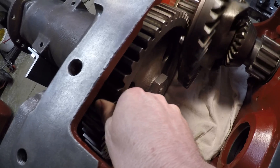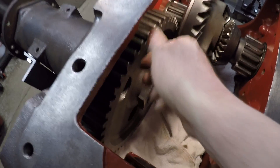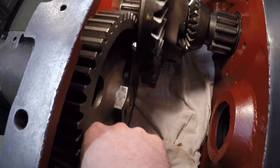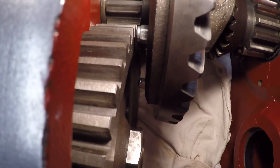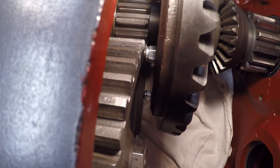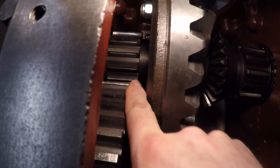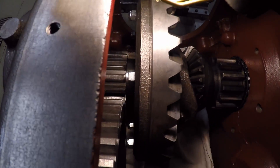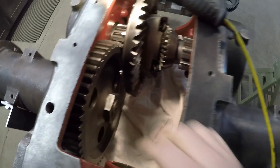Let's do a quick rotation — I can tell it's already turning a lot freer than it did. No signs of scraping, free wheels pretty nicely — that's at least one revolution, so I'm pretty sure we have our clearance issue resolved. Now looking at the bolts on the ring gear, we are darn near an eighth of an inch, and even on a production 445 they don't get any further away than that. I like how the bull gear and bull pinion are pretty much in perfect mesh, not too far into the bearing race and not too far into the ring gear bolts — and it doesn't hit the case. I think we have success. Now to see about the other side.